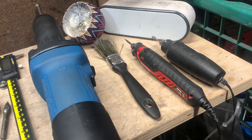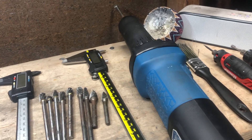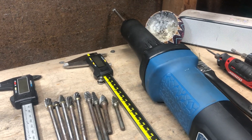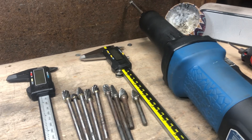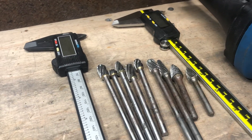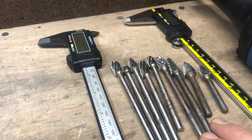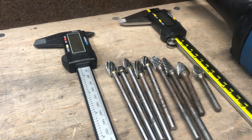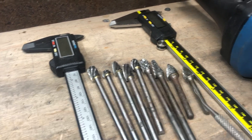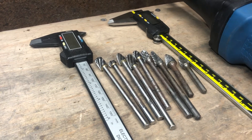You could use a small Dremel or a large rotary tool. I like to have a couple of different ones depending on exactly what area of the head I'm addressing, or what head it is — whether it's an automotive head or, in this case, a motorcycle-style head. They're a little smaller and some areas are harder to get to with a larger bit. There are also different styles and shapes — once you get into it, you'll figure out which ones you want to use, whether single cut or double cut, long stem or short shaft.